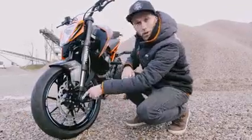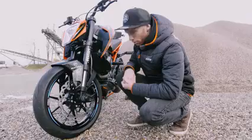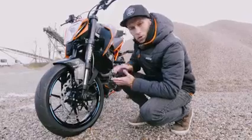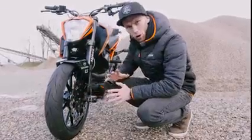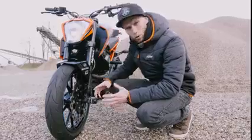As on all my small Dukes, I'm using the oversize 320 millimeter disc from KTM Power Parts — the braking power is unbelievable, really a must-have on your Duke. To protect the front disc and suspension, we added front peg sliders with plastic endings to absorb impacts better.